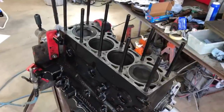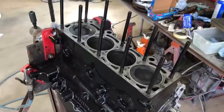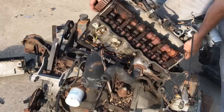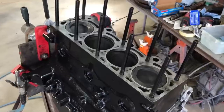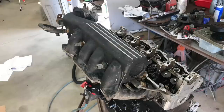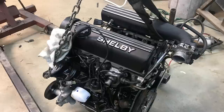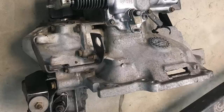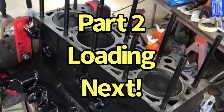Okay guys, there you have it — we have officially assembled our 2.2-liter turbo T2 short block. The only thing remaining, coming up in Part 2, is we need to find a suitable 782 cylinder head, apply a super Richie razor blade rebuild on that head, grab a factory T2 camshaft, a factory two-piece intake manifold, and the factory turbo combination — the turbocharger and exhaust manifold. Get that all together, get the cam on, get everything lined up, so then in Part 3 we can attach it to the transmission, hook up all the lines, get it in the car, and get it running. Thanks for watching — I'm Richard Olden, make sure to like, share, subscribe, ring the bell, do all that stuff.